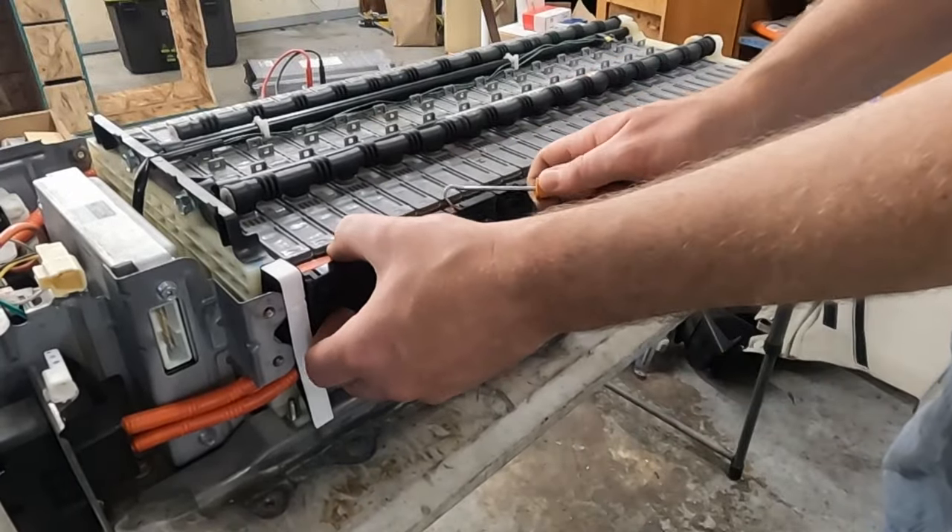That's it. Clear codes if you had a battery code, take it for a test drive, make sure everything's good. That's how to replace a battery with aftermarket cells on a Gen 2 Prius — that's 2004 to 2008. In fact, 2004 to 2015 utilize the same cells, so even though the battery location may be a smidge different, the actual replacement of the cells should be very similar to this process. Keep in mind this is high voltage with inherent danger, but typically it's relatively safe as long as you take a few precautions and check with a voltmeter in a couple places before proceeding. I'll have a link in the description where I got these — you can purchase them online as do-it-yourself kits; they also do mobile installations depending on where you live in the United States. Thanks for watching — like, subscribe, see you on the next one.